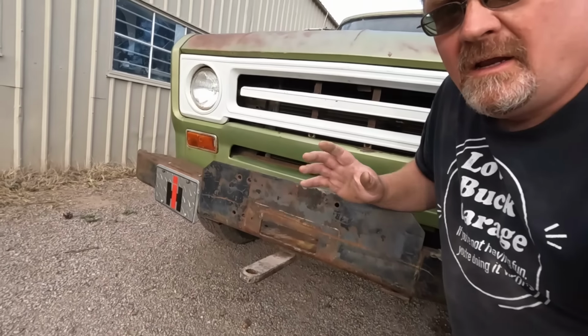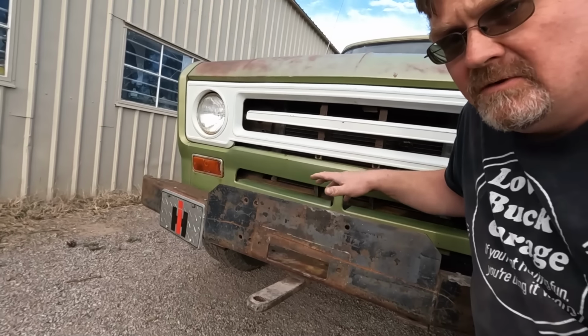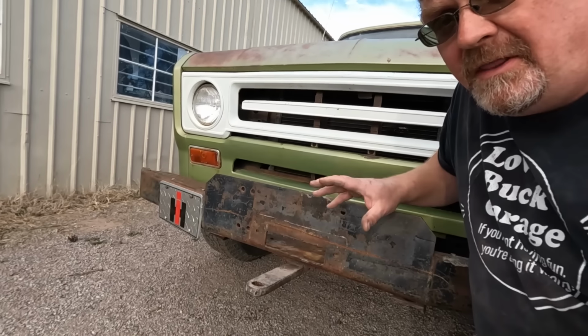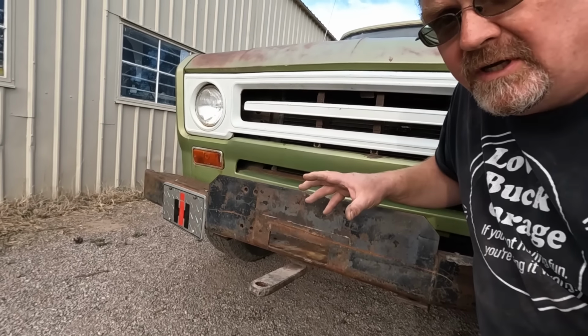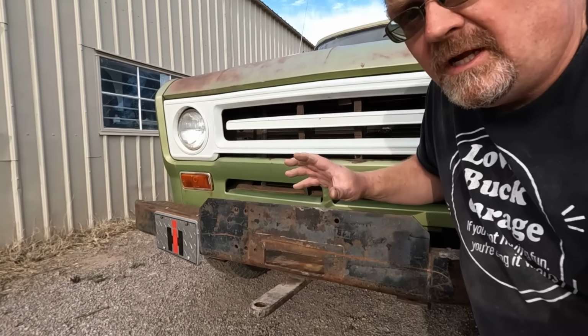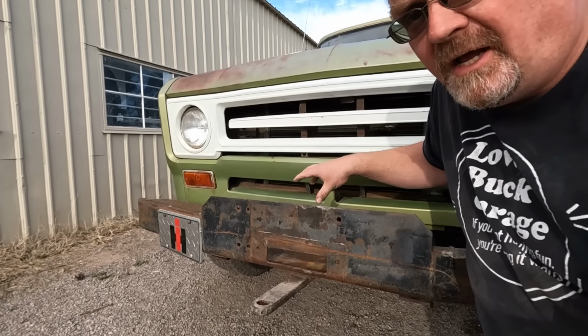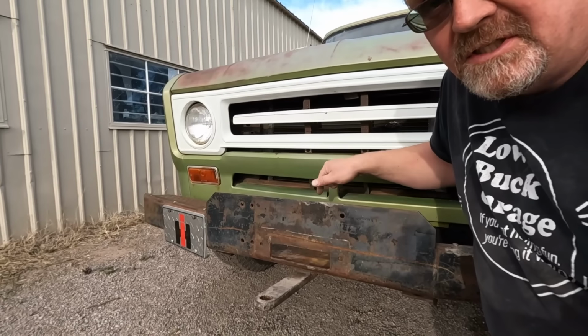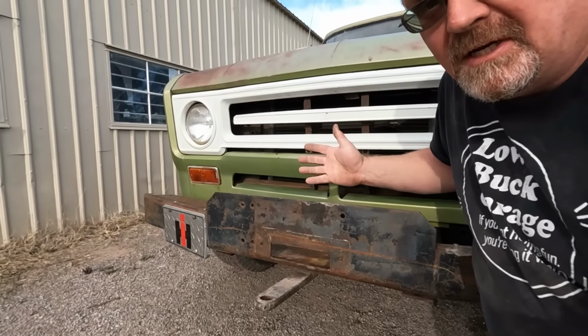I like that. Now in the comments I found out what kind of winch was supposed to be here. It's kind of unique to have the mounting bolts in the front. And apparently that was an early Warn or Bellevue winch, and they bolted on that way. Also, they were electric, but the controls for the electrics were on the unit itself and the brake was mechanical. So they ran remote push-pull cables to the unit up here, which matches my controls.